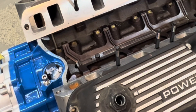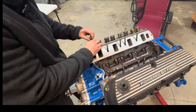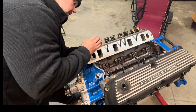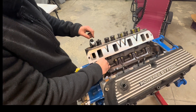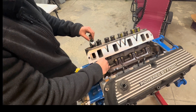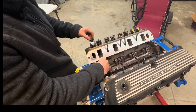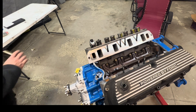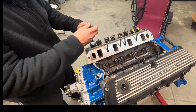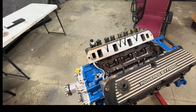With the exhaust coming up, the intake is closed, so now we can go ahead and get this thing installed. Make sure it's straight. Basically, per the instructions, all you're really doing is taking out the slack — there's up-and-down movement, rotational movement — and you tighten this down until that's gone. That's zero lash. Right there you can feel drag and no more movement, no clanging. That should be zero lash.